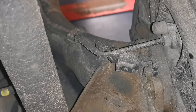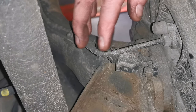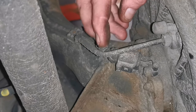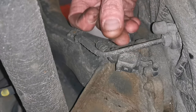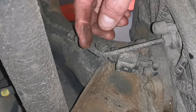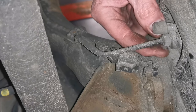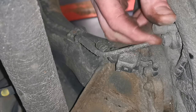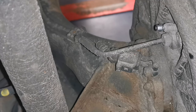At the back here we're going to disconnect the brake pipe. With calipers you usually have a flexible hose and you crimp it to stop brake fluid coming out. In this case there'll be a hose somewhere on the axle, but what I'm going to do is I have wee stoppers made up - whenever I disconnect that I'll just screw one on the end to stop the fluid coming out. There will be a wee bit obviously, but it'll need to be bled.